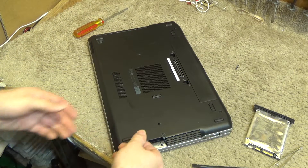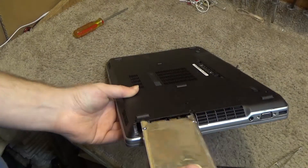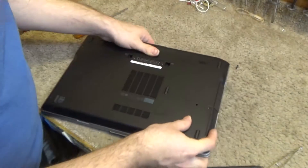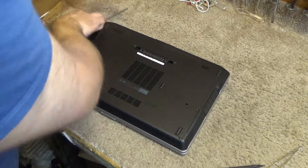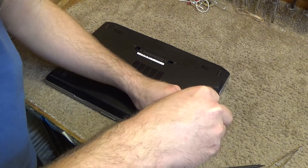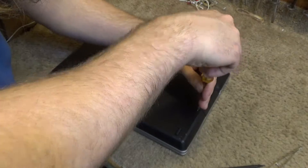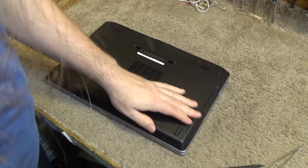I'll put the battery back. Now for the drive — the connectors are up at the top so we may have to angle it up a little bit; it's better to do it like this so gravity works with us. Slip this in and you'll feel it kind of press in, and that's connected. Put these two screws in, and that will conclude the drive and memory replacement.